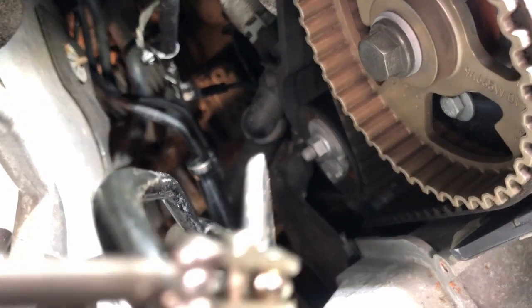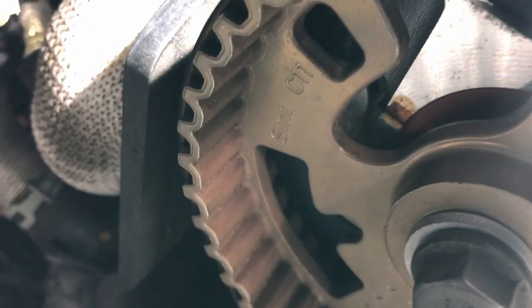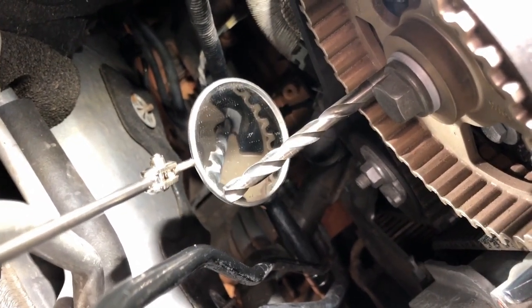I've got a 22mm ratchet on the lower pulley down there and I've rotated it round until the little divot in the cutout is lined up with the hole. If I put this mirror down there you can see how it's lined up. So I've got a 6.5mm drill bit - the 6mm seems to be a little bit sloppy. You can see it's in the slot and goes into the slot behind. So basically that's timed up now.